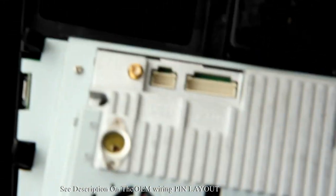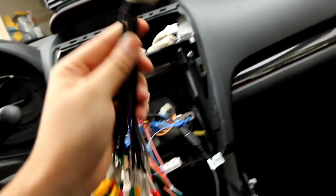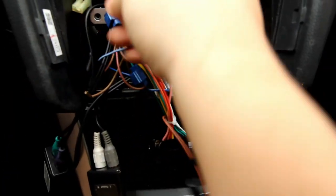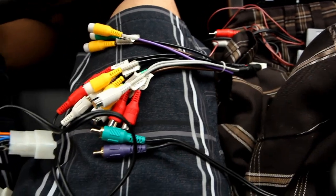Next let's talk about the VTR port, which I believe handles the pre-outs for preamps. You get all these RCA jacks — it also includes things like the front camera, rear camera, and video out if you want to hook up an N64 or PlayStation, etc. Here's the harness I got from AE64 which makes it a lot easier — I believe this is the 10-pin, and then there's also a six-pin that carries the left and right audio jacks.